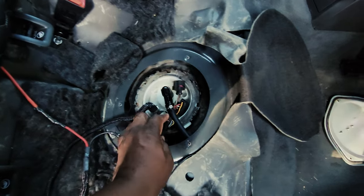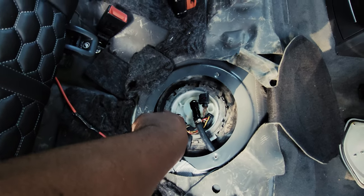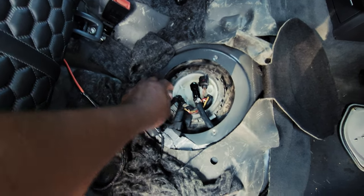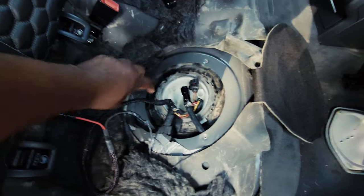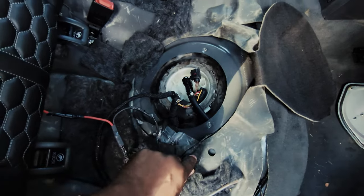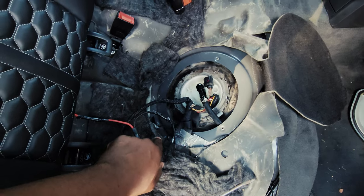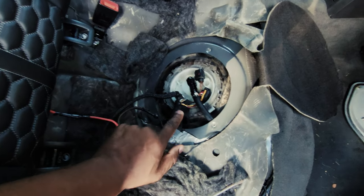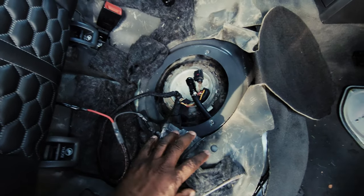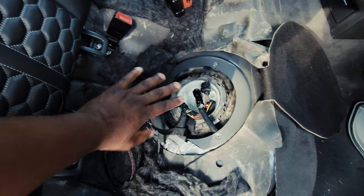This second part is the wiring for the secondary fuel pump — a Walbro 525. There's a specific part number. Make sure you buy from Summit Racing or Eurotuning; I got mine from Eurotuning and will link it in the description. Make sure you get an original pump — there are a ton of Chinese counterfeit copies of the Walbro 525 on the market. It's a 525, not a 535. A 535 will overheat your OEM fuel pump module, but don't go lower than a 525 or it won't supply enough fuel. It's a balance.